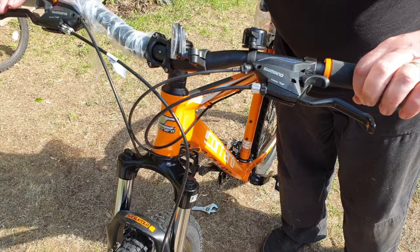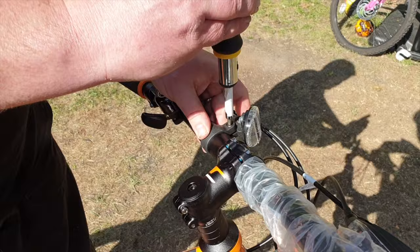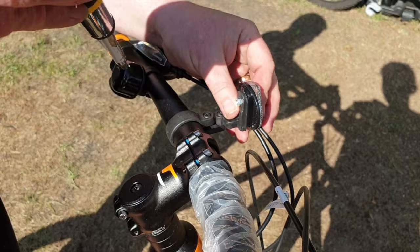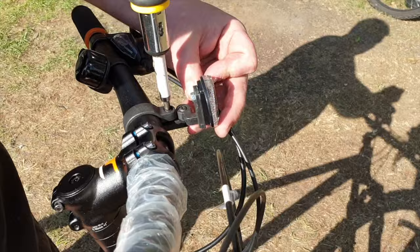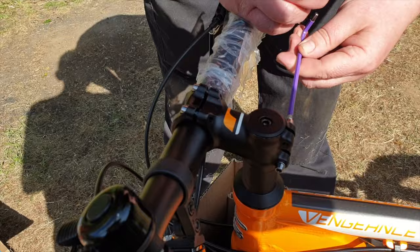You should find you're pretty much ready to go. Just adjust the front reflector with a Phillips screwdriver to make sure it stays in place, check the brakes are nice and sturdy, go through the gears to make sure they're working properly, and position the bell where you want it. Also, as already mentioned, go over the entire bike and make sure all the nuts and bolts are tight so you know you're safe and ready to go — don't assume they all are, because they probably won't be.